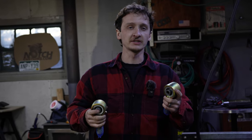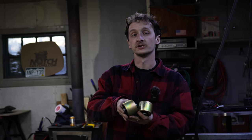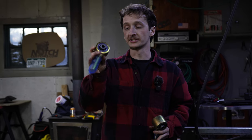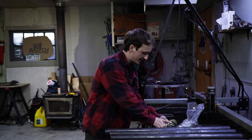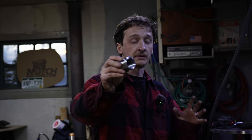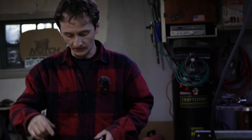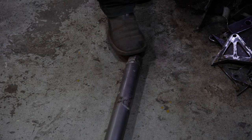Enduro Joints are from Barnes and they seem a little beefier to me. These Johnny Joints actually have a smaller profile, and our upper link is so close to the floor up there - it's probably best that we have a smaller profile joint up there. These are inch and a quarter Johnny Joints with a 9/16 bolt hole. I've also got the tube inserts from Barnes. I like these smooth complete circle ones without the hex - I think they weld up a little nicer and they look a lot better.